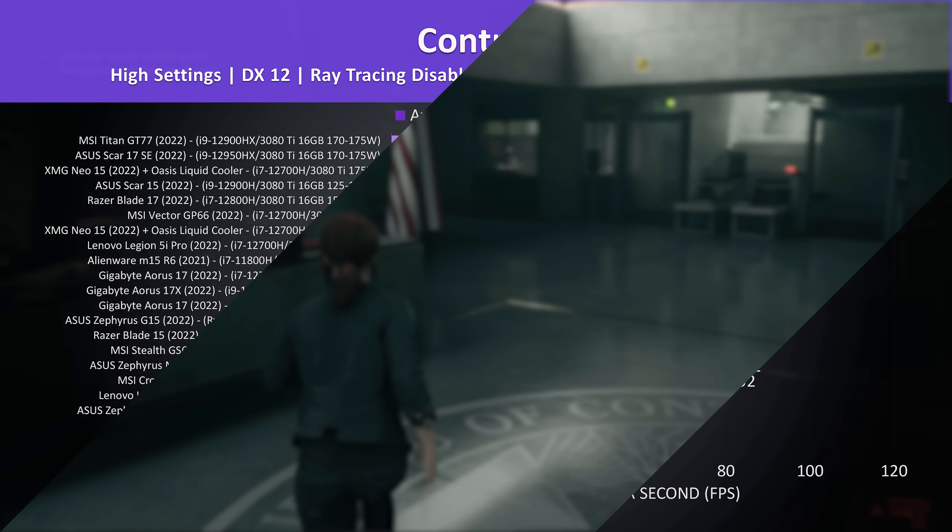We've added Blender due to popular demand, but this time the 17X didn't have the best 3070 Ti — that spot was taken by the Legion 5i Pro with higher wattage 3070 Ti, but it's still beating the 3080 in last year's Aero 17. Specviewperf was also tested, which tests out various professional 3D workloads. The BIOS might not be as modern looking compared to other brands like ASUS, MSI, or Lenovo, but the core basic functionality is still present, though there's nowhere near as much customization compared to others like MSI's advanced BIOS. You can't do any overclocking or undervolting of the unlocked HX processor in BIOS, so that would need to be handled with software like Intel XTU.